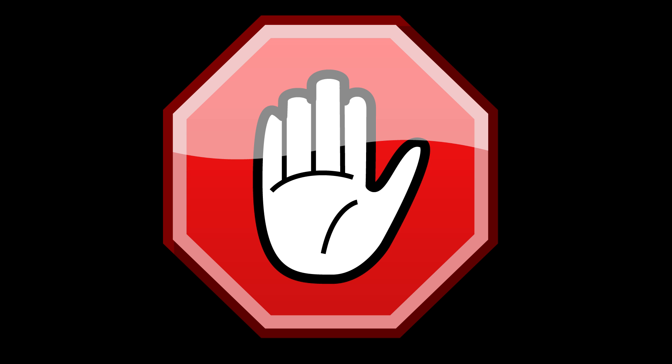If the back screen is just lit and nothing else is really working, holding it down that long will turn the tablet off. Then you can hold it down a normal amount of time to turn it back on. Sometimes the tablet just gets stuck in some kind of funky half-booted mode. Try that first — most of the time that'll take care of your problem. The rest of this video is for people where that doesn't work.